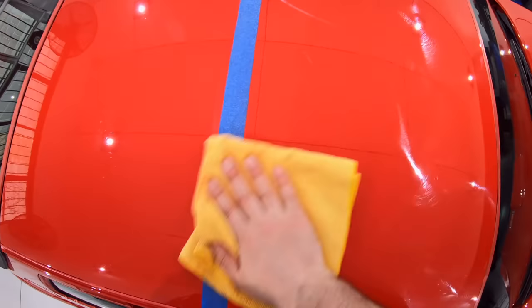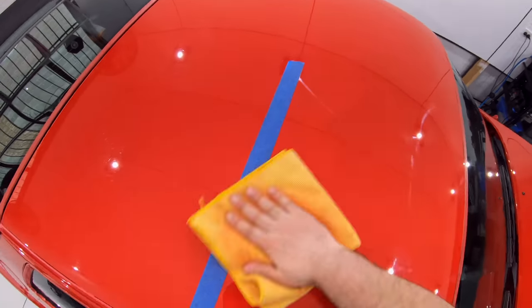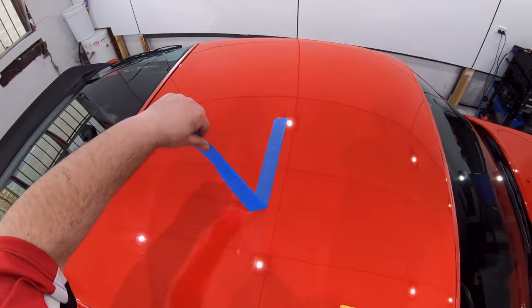So all in all, at least in my experience, it's more difficult to correct plastic and fiber-based substrates compared to metal ones. And apart from some slight adjustments that you may need to make to your combination of compound, pad and machine, you may also need to adjust your technique to match the type of material that you're polishing on.